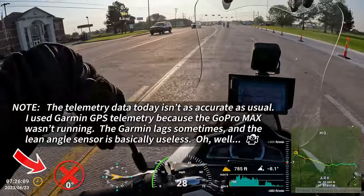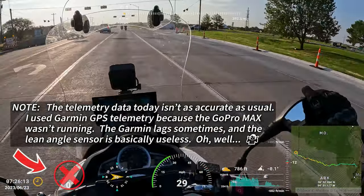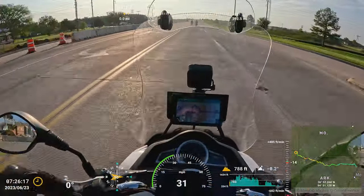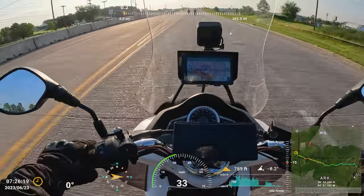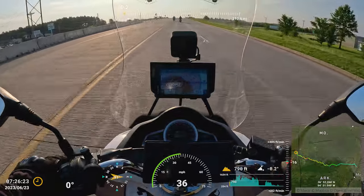Bend this mirror back in place so I'm not looking at my knees. And I got some kind of imbalance with my front wheel. Hopefully not a bent front wheel or something. Because I've got head shake. Like, see? Look at that. I could always go hands off on this thing before, not now. It's got head shake. I don't know what that's about.